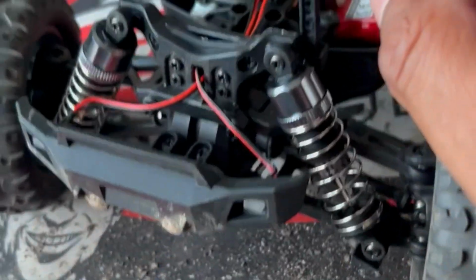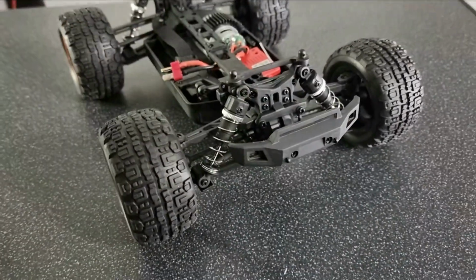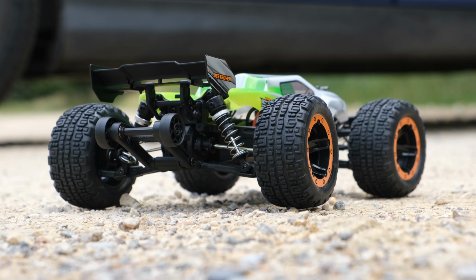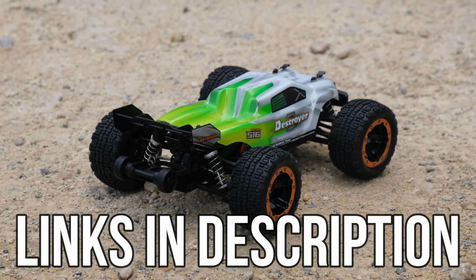Now, regular viewers of my channel know exactly how I feel about friction shocks. I just don't feel like they should be included on any RC cars anymore. Oil-filled shocks are so cheap, I don't know why they do it. Now, the good news is the upgraded shocks for these cars are so cheap and easy to fit, and they're definitely a worthwhile first upgrade.